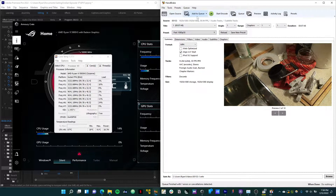First up, we have a Handbrake video encoding test. This laptop has a 35-watt TDP processor, which is generally a lot higher than an average laptop. Most laptop processors are going to be about 15 watts, some are 25, and if you have a gaming laptop or higher-end workstation, it might be closer to 35. What Handbrake does is take a video — in this case a .MTS file — and re-encode it into a different format, in this case M4V, which is similar to MP4. This will put the CPU at full stress, so let's go ahead and kick that off.